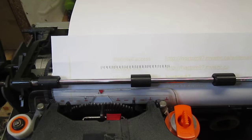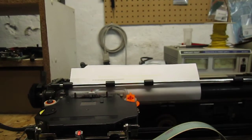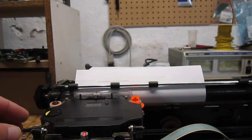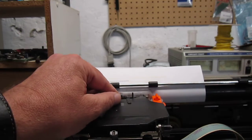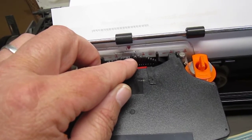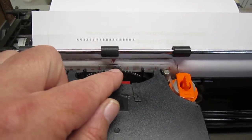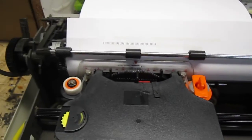Now what that actually is — that's the print hammer. So it's not hitting the letters or the characters properly on the daisy wheel; it's going between them. I'll try and show you here. So when that hammer moves, see, it's not striking the character — it's the hammer that's striking the page, and that's leaving the vertical bars.